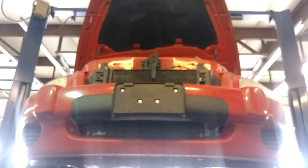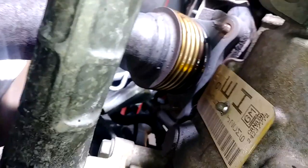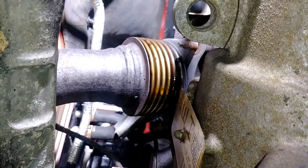We got the HHR back in here fixing the exhaust on it real quick. There's an accordion-style part right there where the pipe comes off the manifold — as you can see right there, it's busted. I just had to use the heat inductor to get the nuts off.